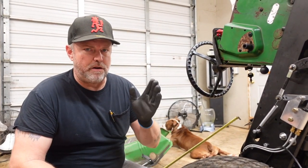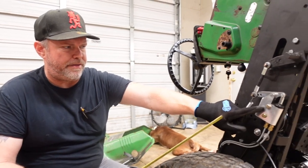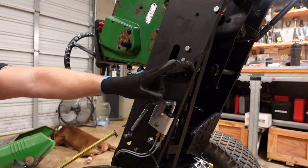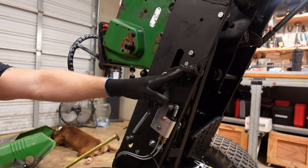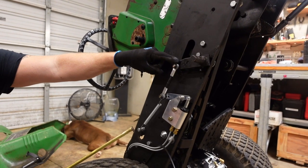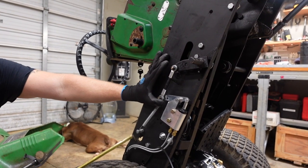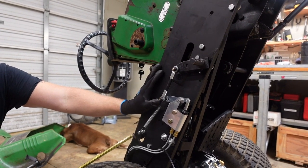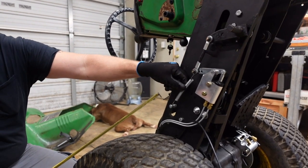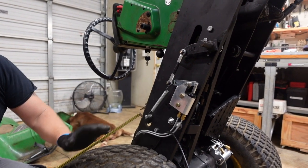The first thing I did was make some modifications to the brake. I think you saw us mount the master cylinder last time — we used the factory brake pedal location and lever and put a heim joint on it connected to the master cylinder. It felt really easy to push the pedal, so I added this spring here into the system and it gives it a little more resistance feel, so it feels more like an actual brake pedal.